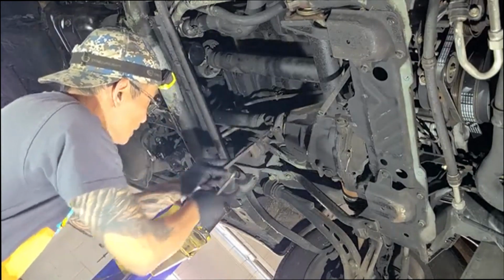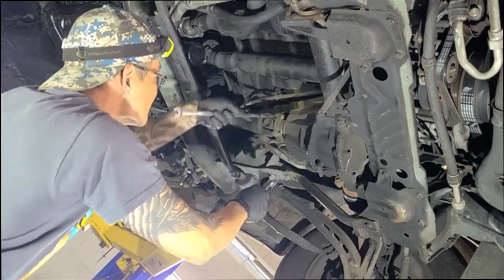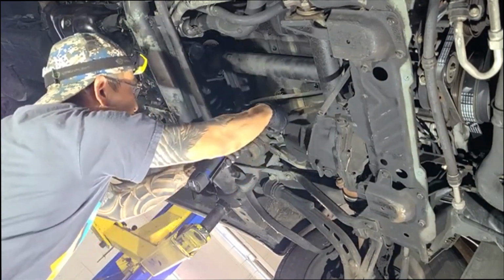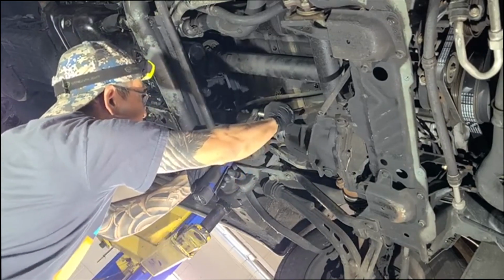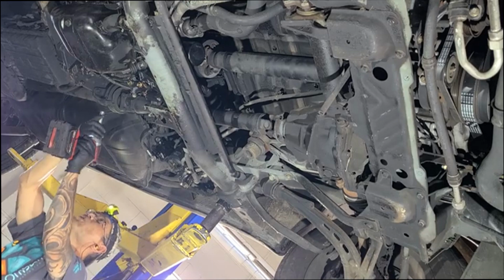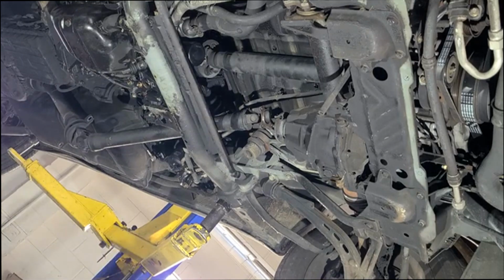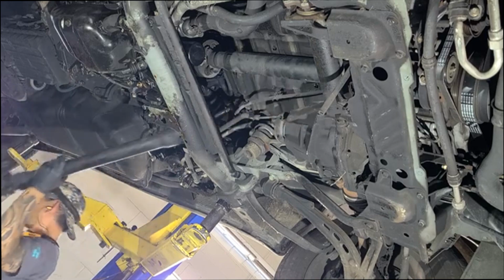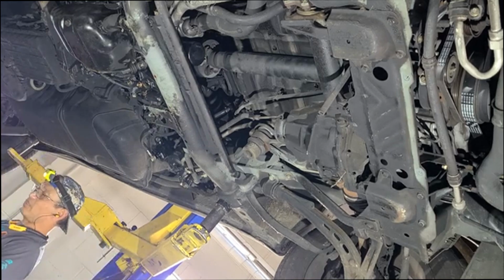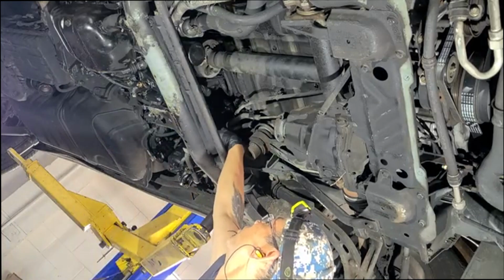This 4-bolt. You have to put it in neutral first. Some light in here. This 2-bolt back here. And then after this, you simply maneuver it out, pull it out like that. Put it down here. Usually this will drip oil back here, so I usually make a plug for it. It won't drip. Now, as you can see, we got some open space here already.